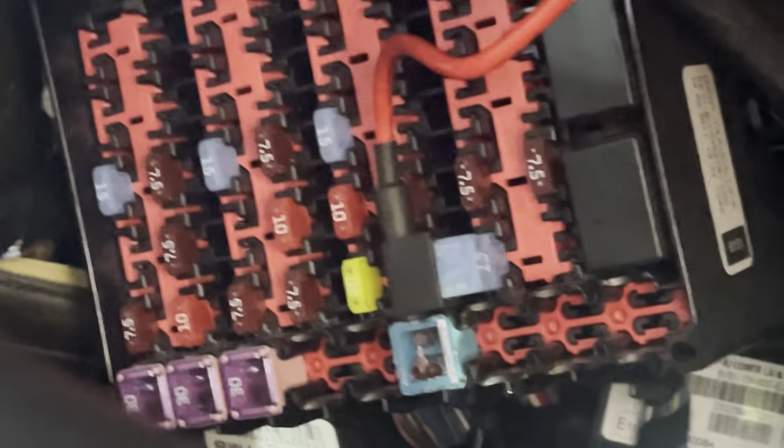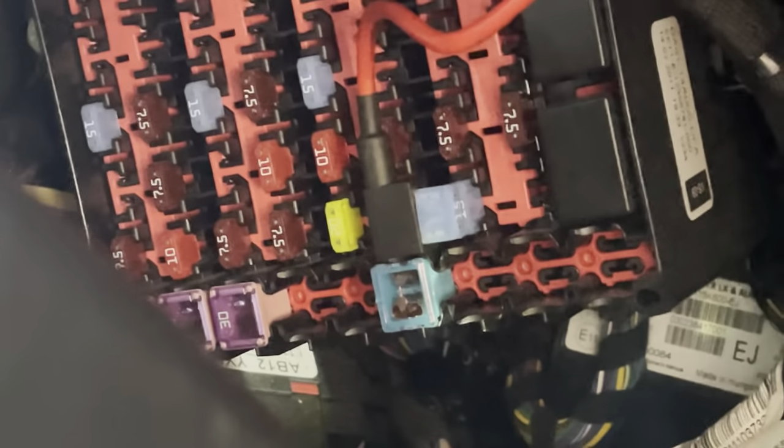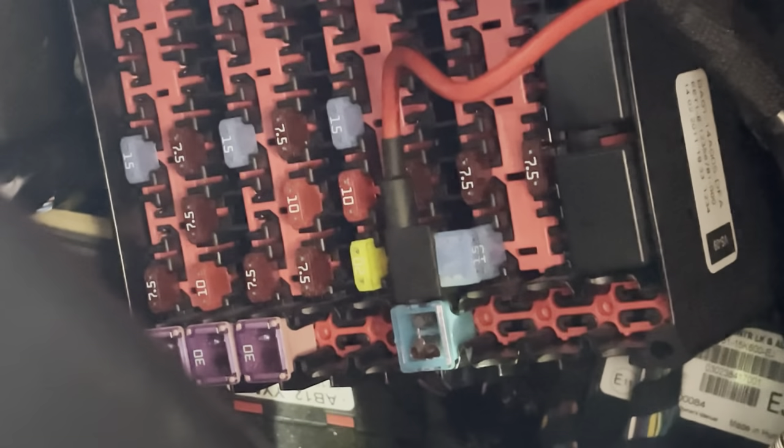In the glove box, the piggyback fuse didn't work too well — the second you unplug one of these fuses, whatever it controlled stops working. I realised the 20-amp controlled my front wipers, which was a problem. Since I have a rear wiper delete, I just tapped into the rear wiper fuse instead, going for the 15-amp next to the 20.